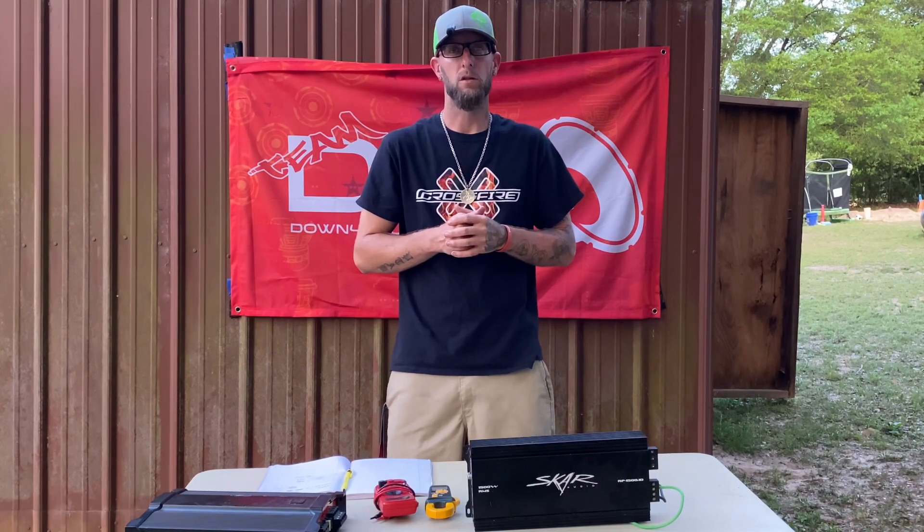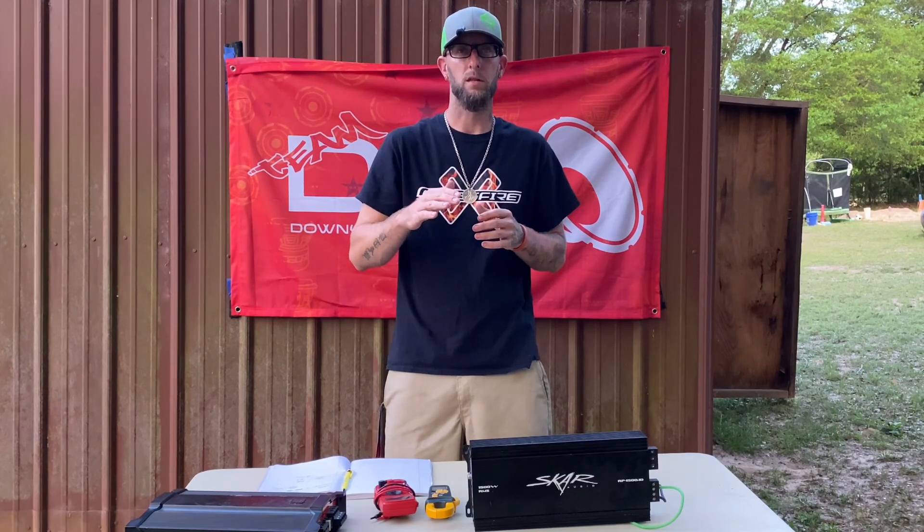But dude, I've got a 2000 watt amp and it's wired up to 1 ohm, so I know it's getting 2000 watts. It slams. Bullshit. Whenever you play music, your impedance is steadily changing, going up and down. It never stays the same and it's never just that 1 ohm.